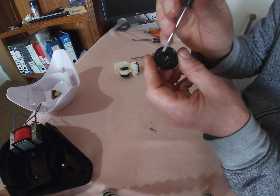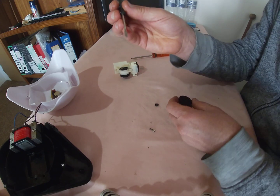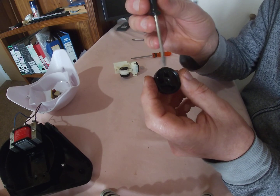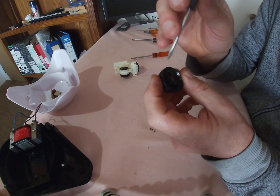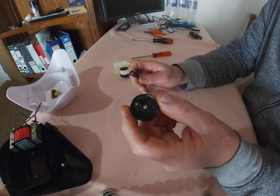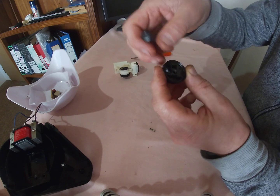Now on the other side, although you might see the hole, I'm just gonna open this up. You'll see here, and I'm not sure if the camera will see this, I've got a very thin piece of plastic here, and that piece of plastic I cut from a thin piece of plastic I had lying around. So you can really find something that is bendy, plasticky, if I can say it like that, or if you have a very thin piece of rubber, it will work exactly the way the old one used to work. But I've already tested this pump, and it actually works quite well.